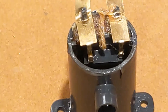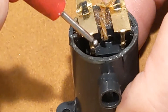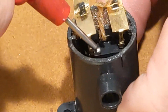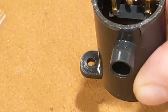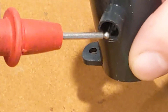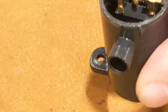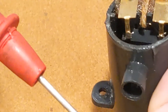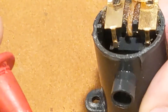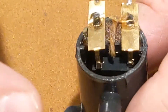What happens is this top has got a lid that goes on it, and the smoke fills up this cavity. A bellows comes up from the bottom — a piston — and puffs the smoke out of this port, which is actually behind the grill of the robot's mouth, so it looks like it's puffing out of his mouth. The eyes flash at the same time, which illuminates the smoke.